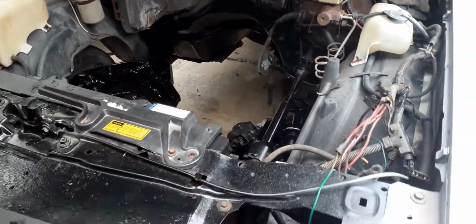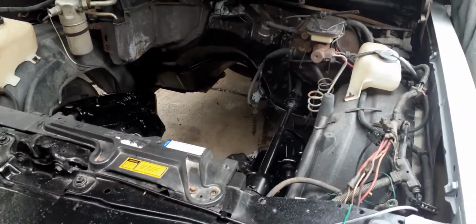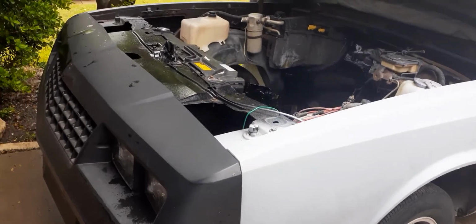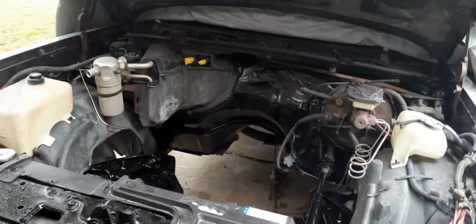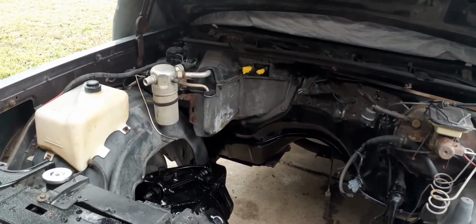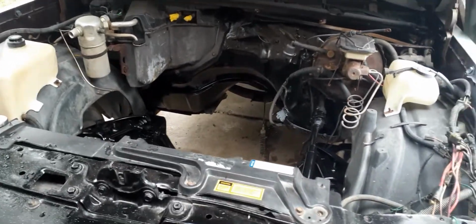Like I said, probably 2 or 3 days worth of sanding, block sanding, and touching up a few areas, like this fender. This fender got a little spot in it. We need to touch that up, put some more filler in that, and do a little light filler work on the back quarter panels, sand them down, and we should be ready to go ahead and spray it, man.